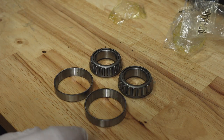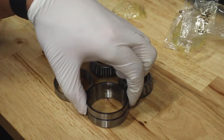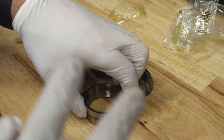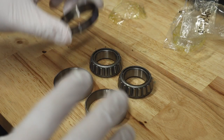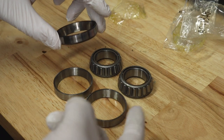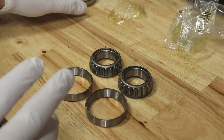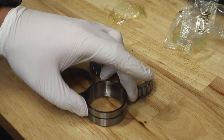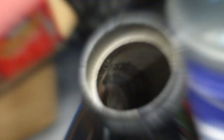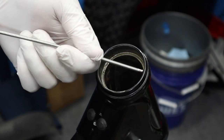We're going to work on installing the races. What we're going to do is take our old race and use it as the driver for the new race — use this flat surface, use our hammer, and just tap it in. Makes it super easy and super simple. Before we do that, I like to put a little WD-40 inside my steering head just to lube up that area between the race and the frame. The other method is with a seal driver — I'll put a link below for those tools. So we're going to use the old race to install these. Just put it on top, hammer it in, same thing on the bottom, get it nice and flush.